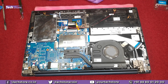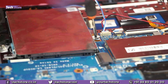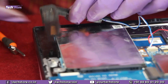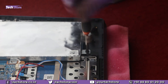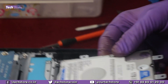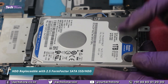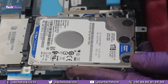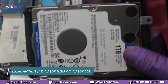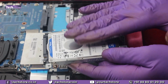For the hard drive, remove two screws — one is under the Lenovo sticker, which you can peel or just drive through. Then remove the speakers to access two more screws underneath. In total, four screws have to be removed, then push the hard drive out of the bracket. You can install a 2.5-inch SATA drive — up to 2 TB for HDD or up to 1 TB for SSD. Remove the four bracket screws, take the hard drive out, and fit the metal casing onto the new drive before reinstalling.